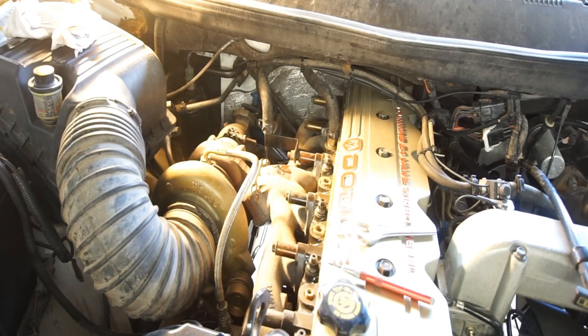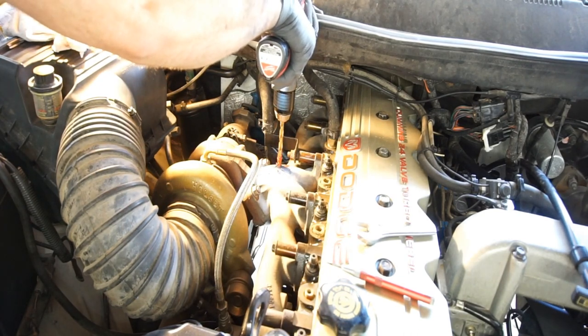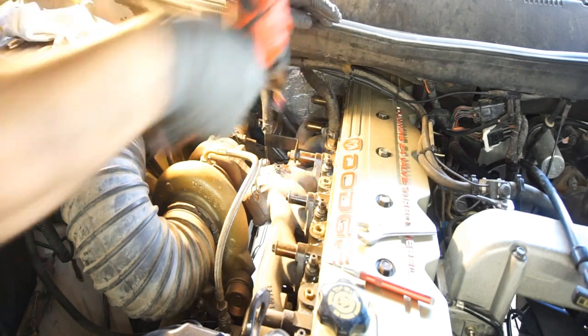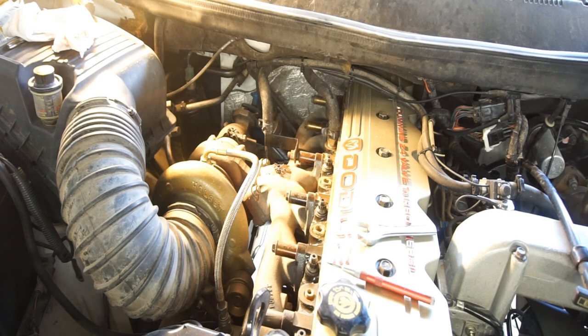As you can see, a lot of grease. Just use what you can. You don't want that stuff getting down in there. You don't really need cutting oil either, because the grease will get hot and act like a cutting oil. See all the shavings? It's good. Good old tip my pops taught me. He's an old school machinist.